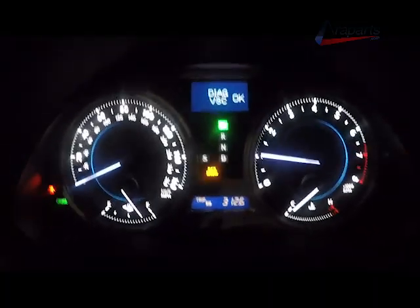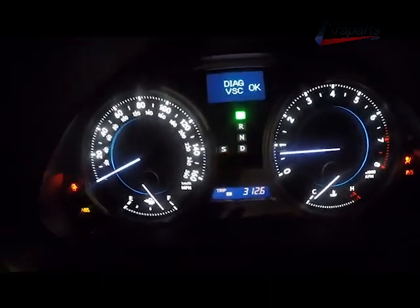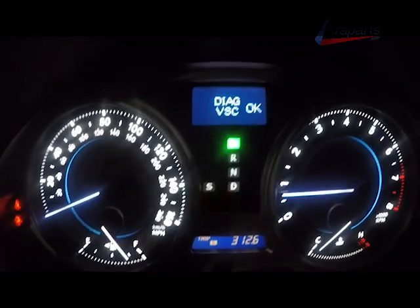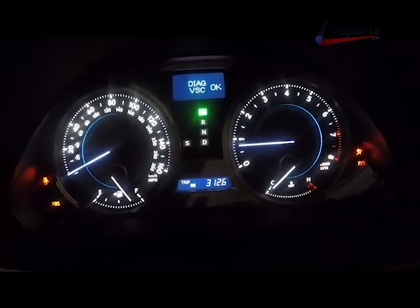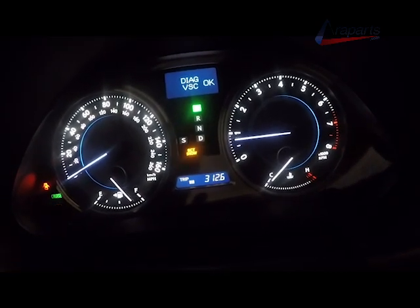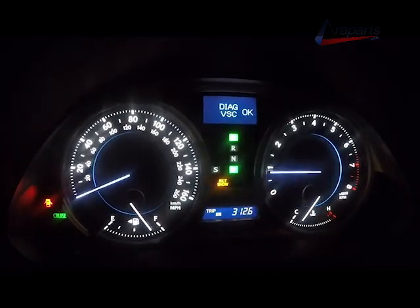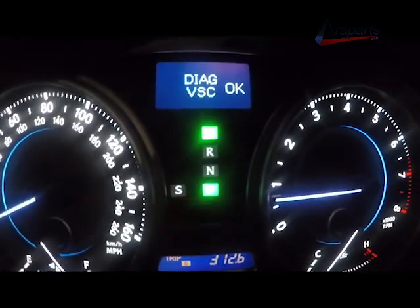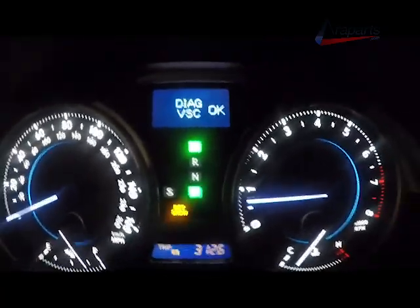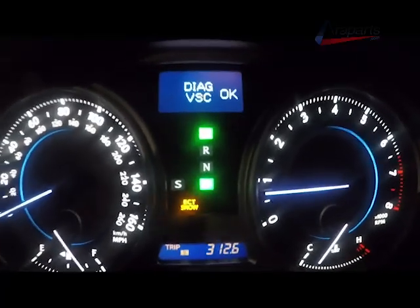And here the drive indicator is off, indicating that the transmission fluid temperature is below the desired range, which means it's under 41 degrees Celsius or 106 degrees Fahrenheit. Here the drive shift indicator is on, meaning that it's time to get underneath the car and open up the check port. This is that indicator that you are within the desired temperature range.